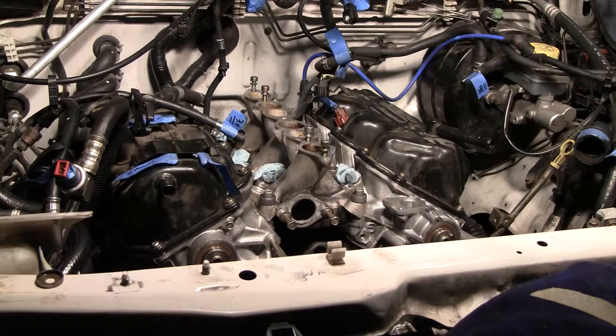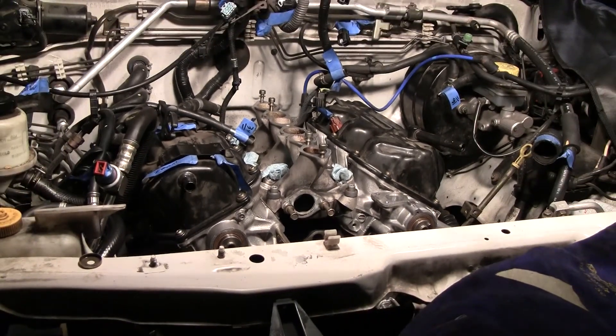It's Wednesday, July 17th or so. As you can see, the engine is exactly where it was — I haven't touched it since. I have something to confess: on Saturday when I installed this with my friend, I was really hyped about getting it all done. Beyond my better judgment, I noticed when we were installing the driver's side head that one of the rings on the head gasket had got a little gashed.